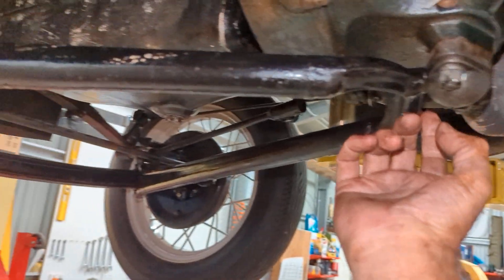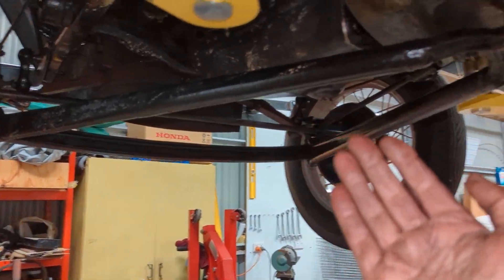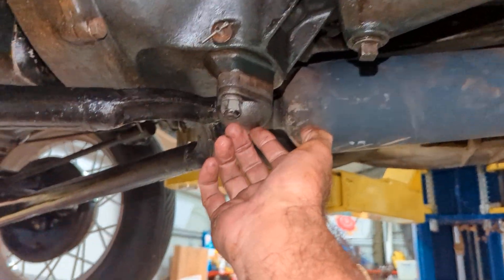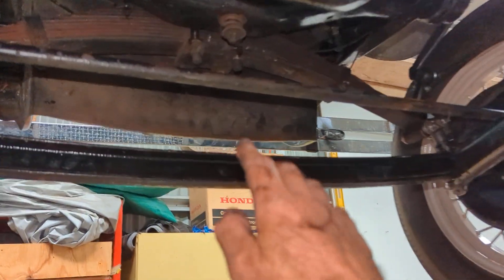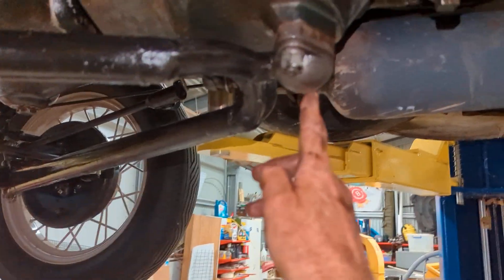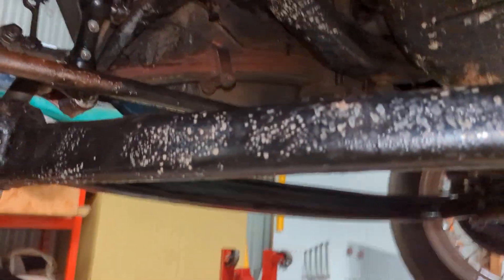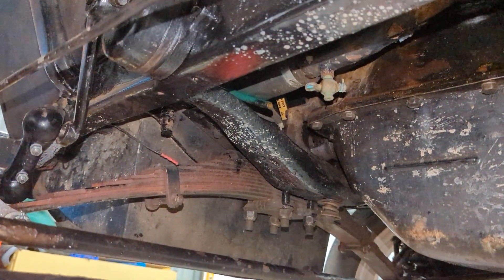I'm not sure if that's just the fact that the suspension is at full hang and the caster is forcing it back or whatever. But I have to put a big crowbar in and lever against the front axle to be able to get some alignment to put that cap back on. So to me, it looks like the cross member is in the wrong position.